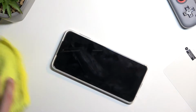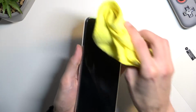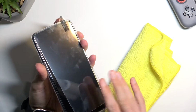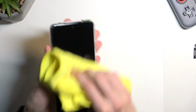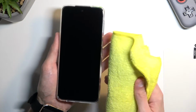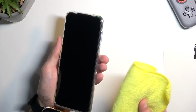So anyway, let's now get to cleaning off our display. One more thing I'll mention is I do have a case on my phone. You can do this with or without the case. Doing it with the case might provide you with additional bumpers. So if you place the glass a little bit off, it will never really stick to the display fully, so you can easily lift it up and realign it. Without it, if you place it a little bit to one of the sides and you put on the case, it might lift up the glass again. So something to keep in mind. It might be easier to have the case already on the phone if you're using it, and this will prevent the possibility that you put on the glass, then you put back on the case, and it kind of lifts up the glass.